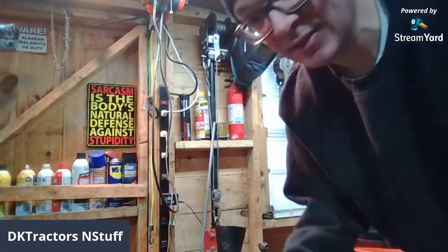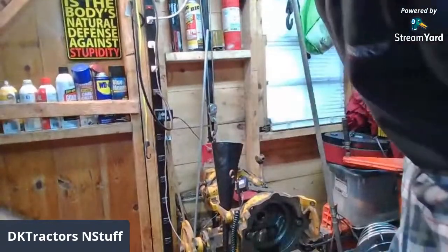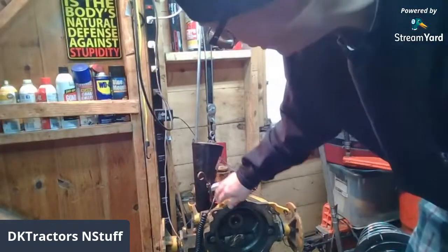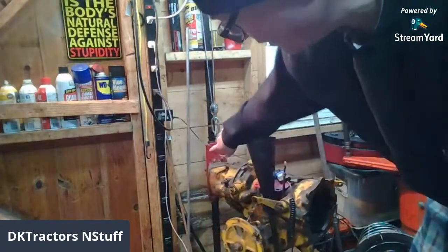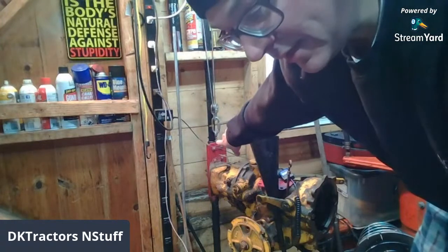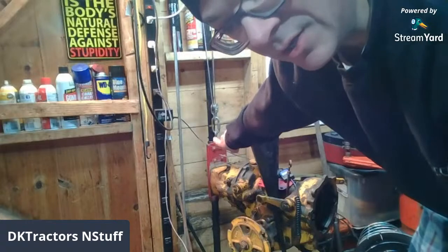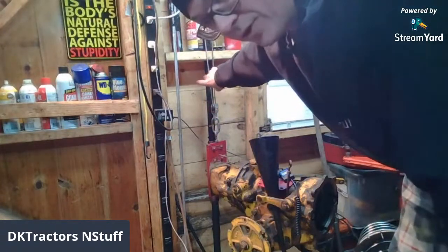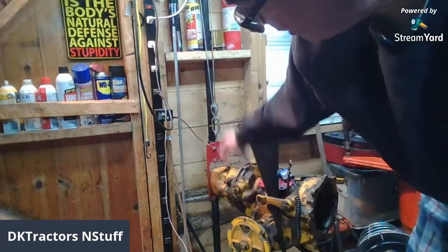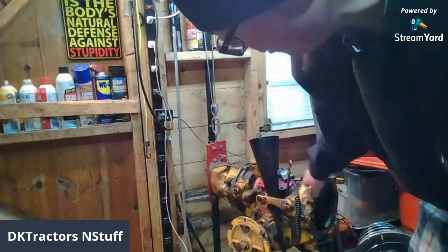Yeah. When I need to raise it or lower it or take it off the ground to service it, I just do it. All it is is a plate that goes to a 1.25 inch pipe that's a foot long, which is then over a 1-inch pipe that's bolted into the wall. Oh, as a guide, yeah. So basically it's just greased up and slides up and down the pole.